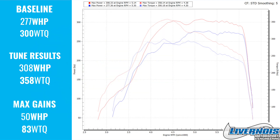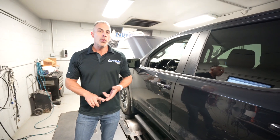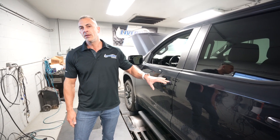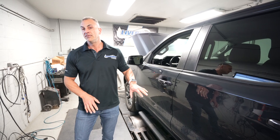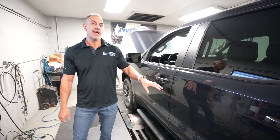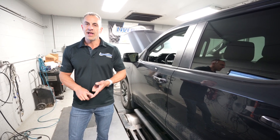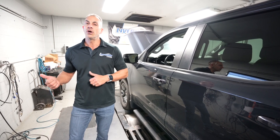One of the things I was really annoyed by driving this truck was the lack of low-end power — it just felt like something was holding it back. There's some torque management and other things we address in the calibration to really spruce this thing up. Throttle response was much better after the calibration. We did a lot of things to improve that. There's obviously a speed limiter — we raised that, which is a super annoying thing for a lot of people.